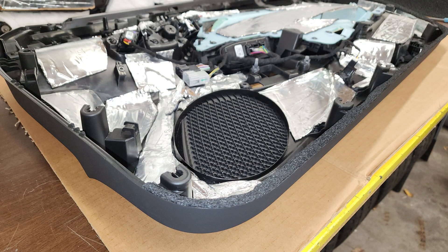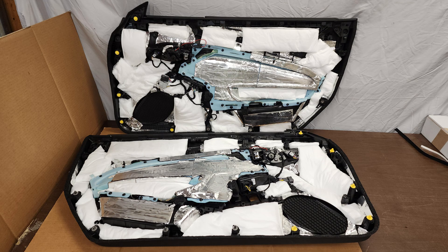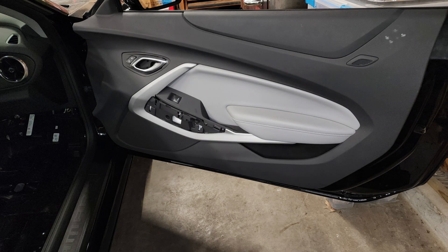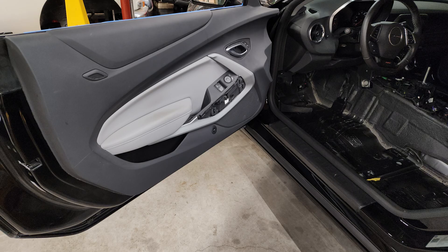In episode seven we finish the doors, which means the door panels. We cannot simply put thin, flimsy door panels on these nice metal doors. We actually have to apply a lot of CLD and then fiber mat and some closed-cell foam to get to a point where we can actually close these doors up and then ask the question: was it all worth it? Stay tuned.